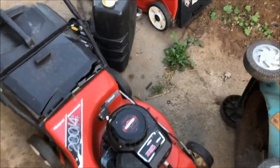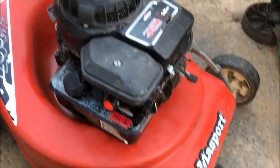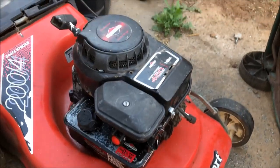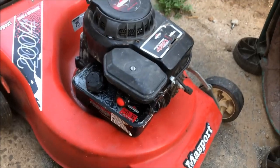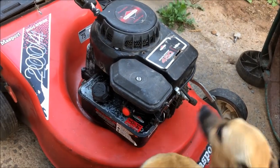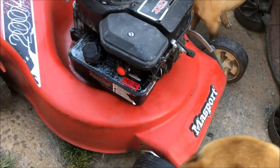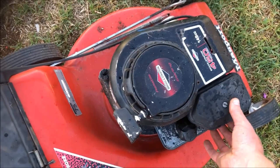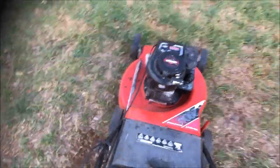Got a little bit carried away - everything's put back together except the catch flap, which I'll do next. Ended up putting a new diaphragm and new prime bulb on the carb. It runs quite well, so I'll quickly change that catch flap and do a start for you, and quickly clean it up for sale.